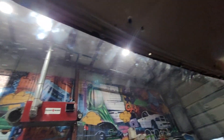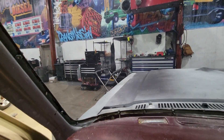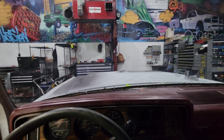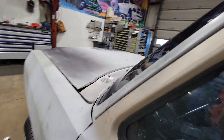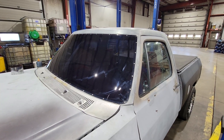I don't have any of my trim pieces on yet, so you can see all the hardware that bolted the windshield in. Once we put all the trim back in you won't really be able to see it — maybe a little along the dash but that's it, and I can deal with that. From the inside it doesn't look too dark, it looks pretty good. The hardware turned out really nice — it takes some work to countersink them all perfect like that. These are just Allen head 8-32 standard size countersunk stainless hardware, available at the hardware store for about 55 cents a piece.